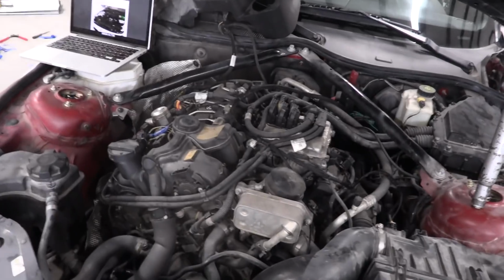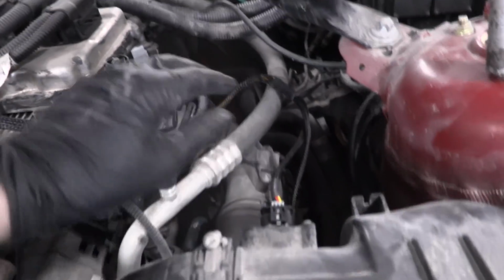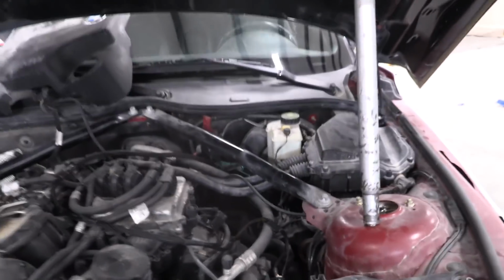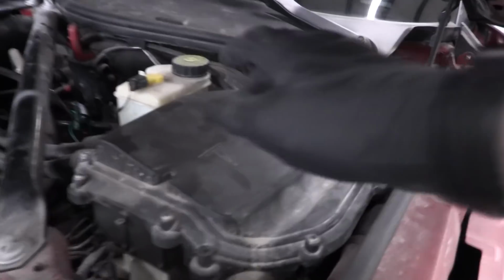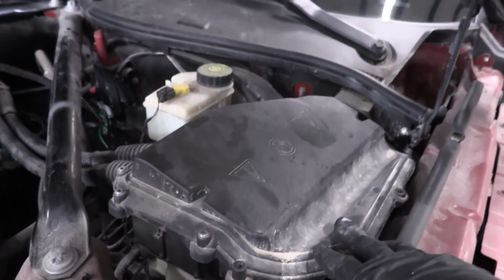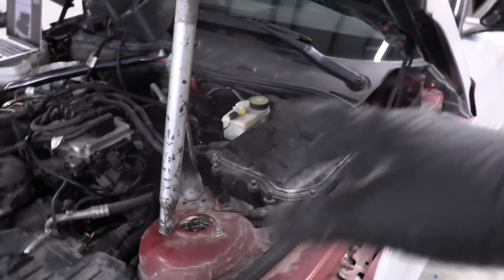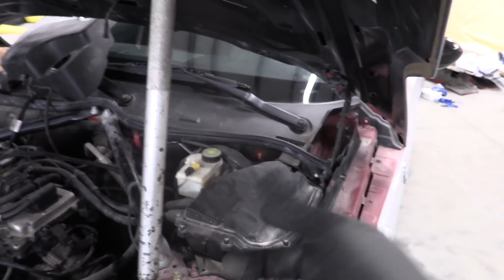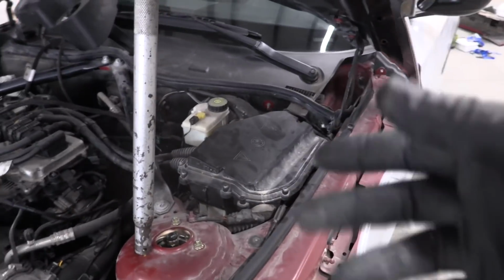So we've got boost solenoid intercepted, T-MAP intercepted, MAP intercepted. That's the three main ones. Then the tuning box comes over here, and now we're gonna go ahead and wire it in, and it's gotta be wired into some wires that are inside this box. So I gotta go ahead and open it up. This is all obviously a battery disconnected type of installation, so the battery's been disconnected this whole time. I'm gonna open that up, continue to follow the instructions. I would assume we're about halfway there, and we'll get that all wired in, and we should be able to start fiddling with it.